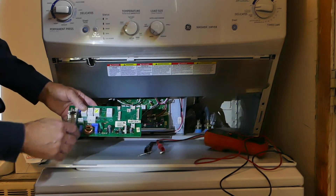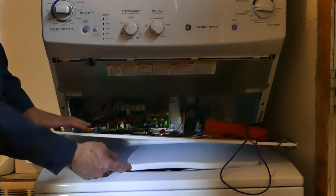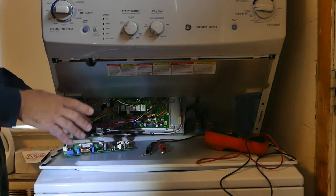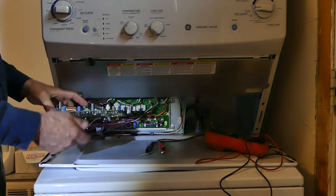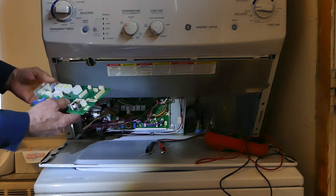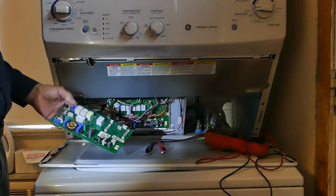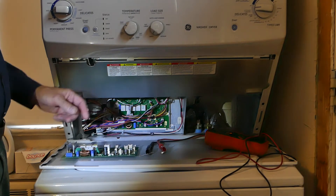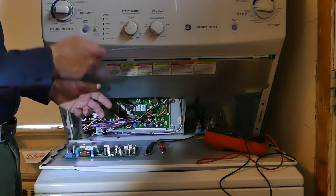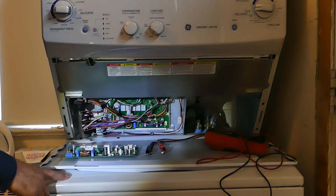You won't have that unless you have the 110, so then you check your lid switch. The lid switch tells the computer the lid is closed — it will not enable operation with the lid open. It's a magnetic reed switch; the magnet is in the lid. It's a two-pin connector: put it on ohms, open the lid, close the lid, and you see continuity come and go — demonstrating your lid switch is good.